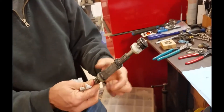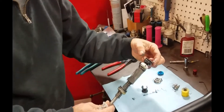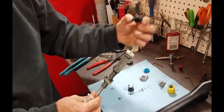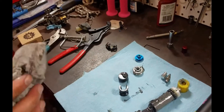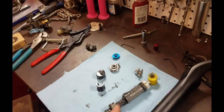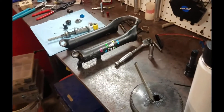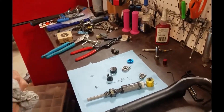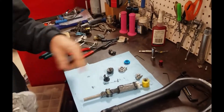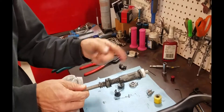Or like if you have the other 100 mil fork and you wanted to lower it, whatever you want to do. So there's an O-ring on this piston. We can put a new one on there since we have it apart. And what is this grease here? The gray stuff? This is slick honey, or some form of it. I've got that stuff. Is that gray color — does that mean it's fine? No, that's every one I've taken apart. I think just from the cycling and the aluminum spring, you can still see there's some clear to it there.